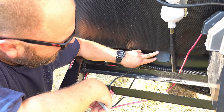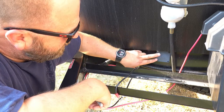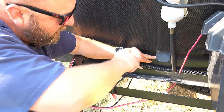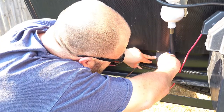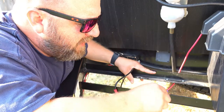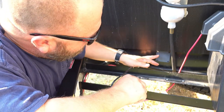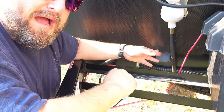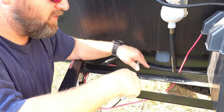I've taken the cover off the back of the disconnect switch and put it up here. I've drilled one hole to make it easier to mark, put the bolt in, and I'm holding it up so it won't move. It looks like the lower two holes — the battery frame the battery sets on — is going to be in the way, so I'll drill the top two first, then take the plate to the back side and mark from there so I can drill from the other side.